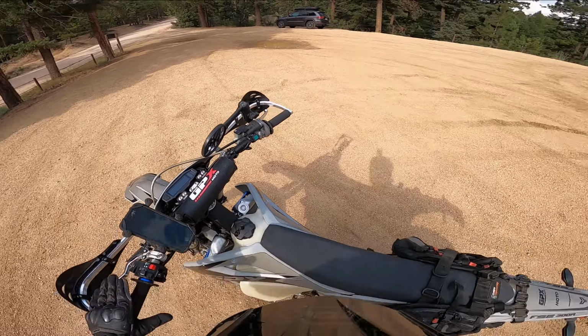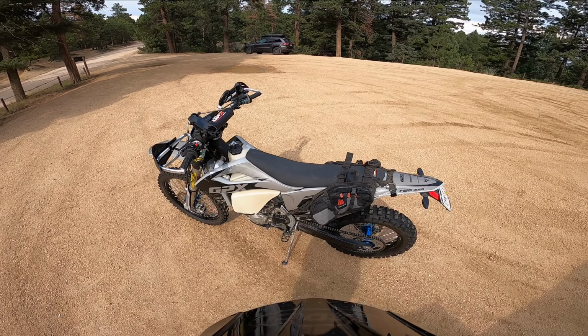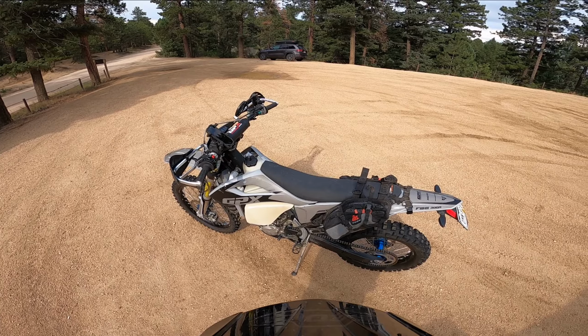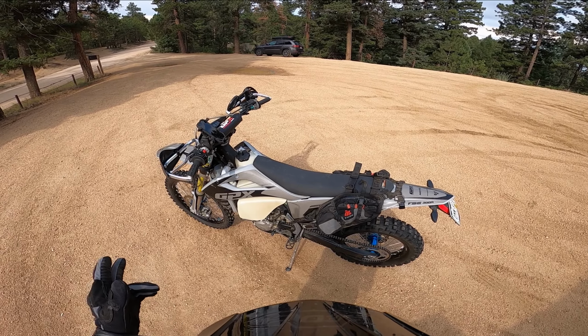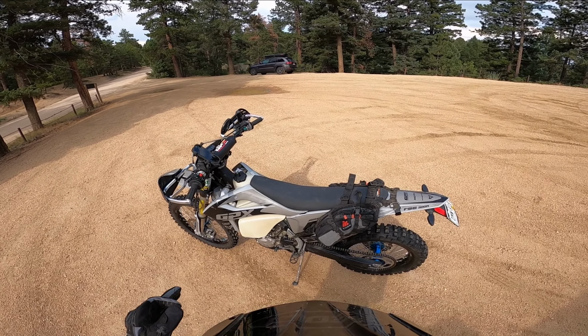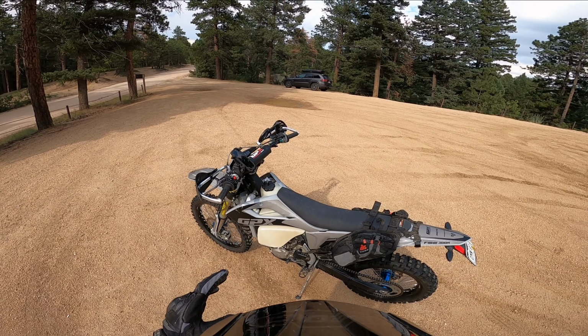I am looking to try to finish up my tune on the double overhead cam 300R. And what I have on here right now is an open loop tune, which I've changed around my open loop fueling a good bit. Engine braking's modified, spark's modified. I think spark's about, I think it's 5 degrees advanced.